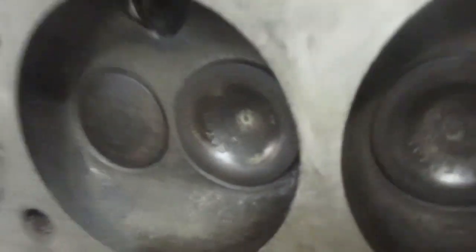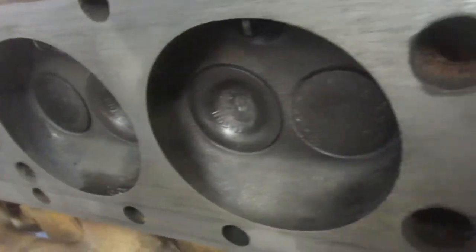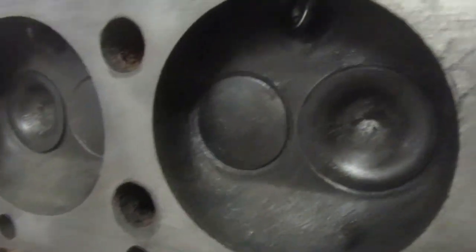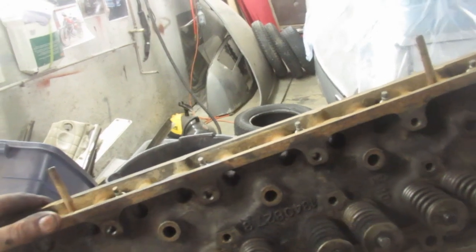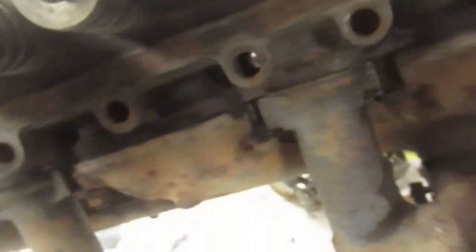The interesting intake valve with the little swirly port there. Oh yeah, it's a real pain. And that's, I think, part of the fireball design anyway. We'd still be cleaning. So we got the whole thing done, in just the time it would have taken to clean it. And there's actually literally rusty valve springs, eh? But luckily there's two dual valve springs, so when that one just fractures, we'll just have to keep the revs down a bit.